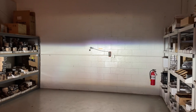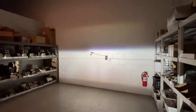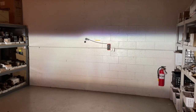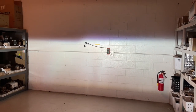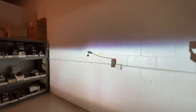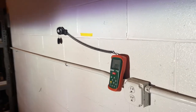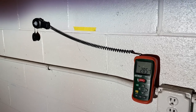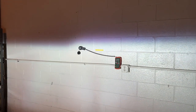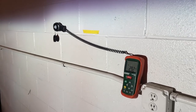This is the factory Honda Civic halogen projector with an HID bulb — a Heartray 5500 Kelvin HID bulb. You can see the output is not quite as consistent as the RX350. It's a little bit spotty. You have some shadows going on, some streaks. Most importantly, you've got what we call the squirrel finder — it's a little bit of light above the cutoff. And the cutoff is not quite as sharp as the RX350 or as colorful. We're hitting about 280 lux, which is a great upgrade over the factory halogens. As far as bang for the buck, something you can install by yourself, this is a solid setup with the HID system, but it's just not quite as good. You'll pay a premium on the projector conversion retrofit, but you'll get some additional features that are really nice.